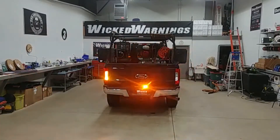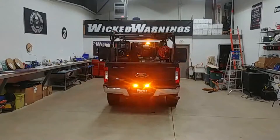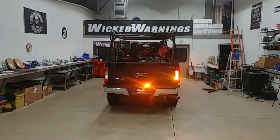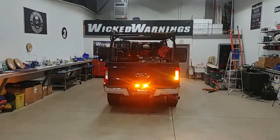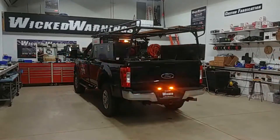Here's what we're looking at facing straight backwards. We did utilize the black plastic filler panel underneath the tailgate — it normally holds three DOT red lights for a dual wheel truck, but since this truck does not have dual wheels, we were able to mount our Thin-X on that black plastic and we kept those amber as well. We have an amber LED HAW DUO set in HD in both the cargo as well as the reverse, and that TIR-3 facing sideways on the rear tails.